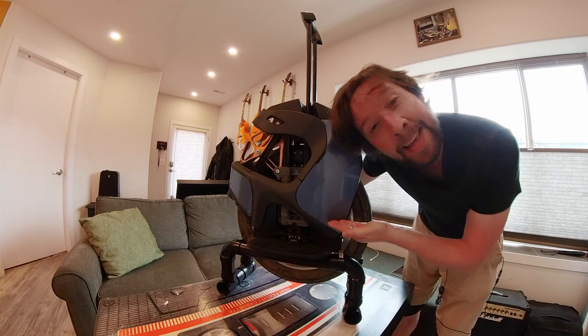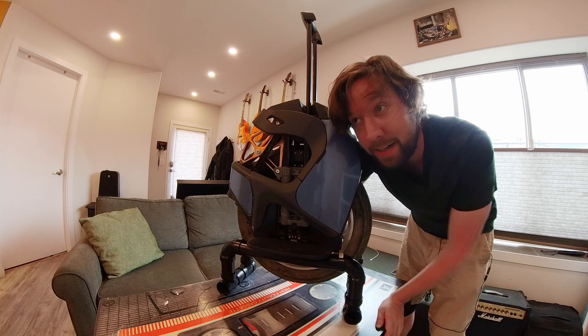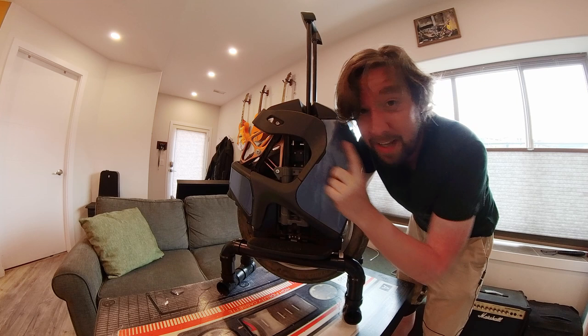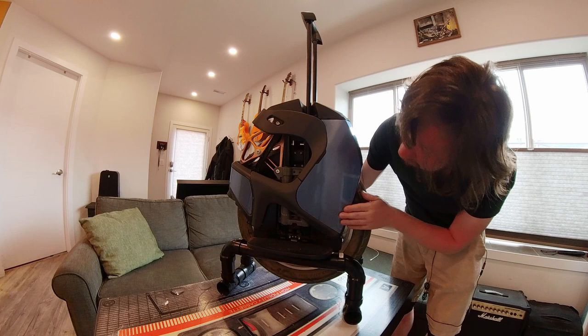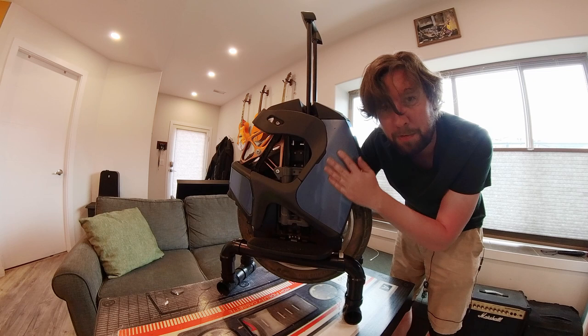Here it is, all put back together. The screws are kind of a pain to put back in — I'd suggest having a butter knife or pliers so you can pry stuff down to get a screwdriver in; that makes it easier. I think it turned out pretty good — it's pretty forgiving stuff. It looks really nice and smooth. There are a couple of little bumps because I didn't sand down this panel, so if you're gonna do it, sand it down and make sure there are no imperfections in the panel before you put on the vinyl wrap. If you enjoyed this video, please give it a thumbs up — I'll catch you guys in the next one.